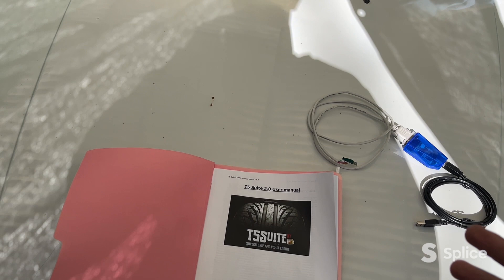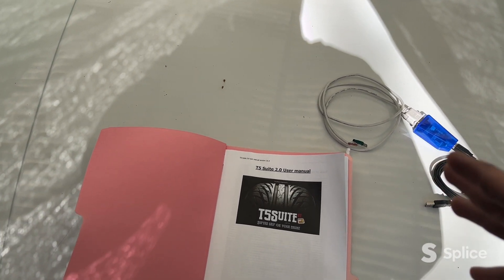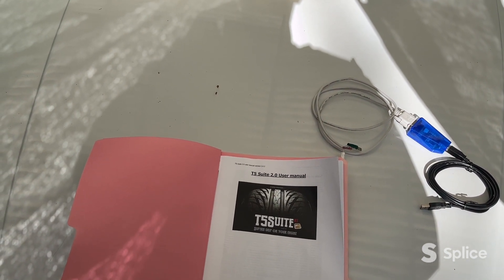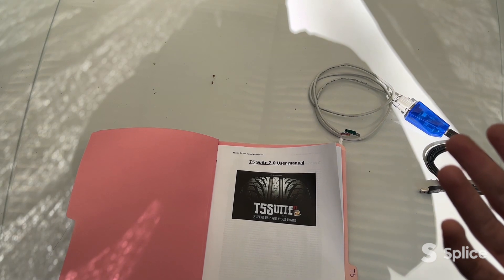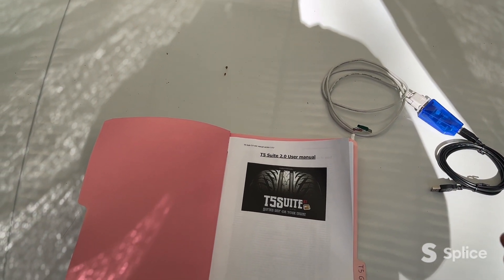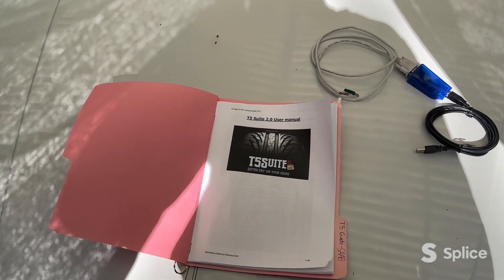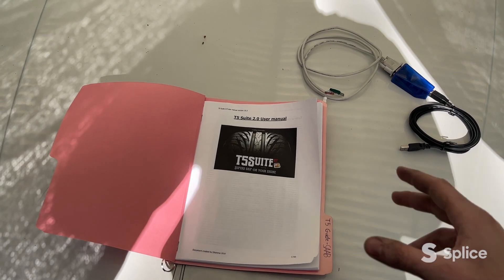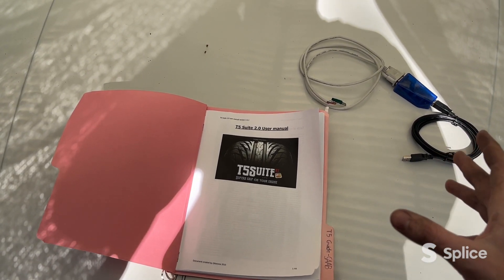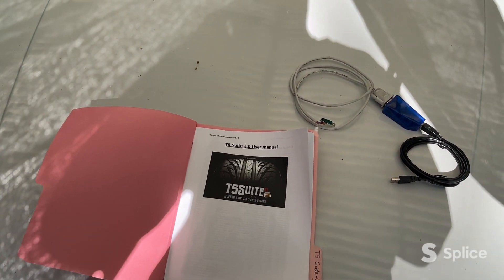I did all that and I haven't really touched anything inside the engine. I think to do this right I would need the turbo pistons, the cam, the camshafts, and maybe even the sodium-filled exhaust valves. But maybe one day I'll get there. Right now I just want to tune it low boost as a reliable car.